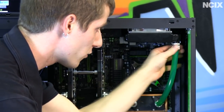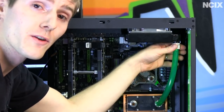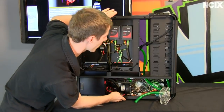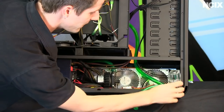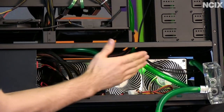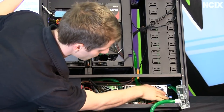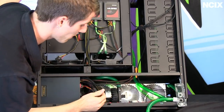If you're having trouble getting tubing over fittings, dip it in hot water to soften it — which is what we'll have to do to get the 3/8-inch tubing over the half-inch barbs built into the MCP-655 pump. In the bottom section, the tubing coming from the end of the loop feeds into the bottom port on the radiator. Radiators won't have more or less performance based on which port is inlet or outlet, but with the radiator laying on its side, feeding from the bottom makes it much easier for air bubbles to float up and out into the reservoir.